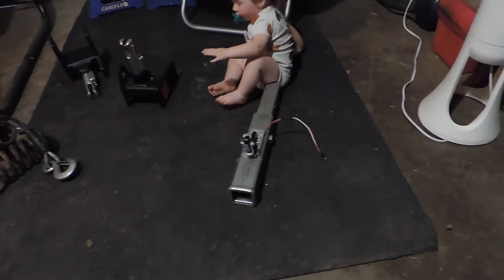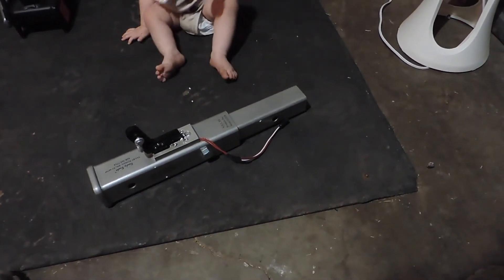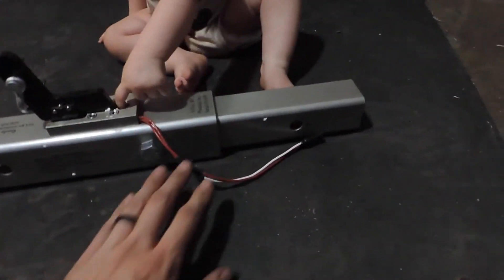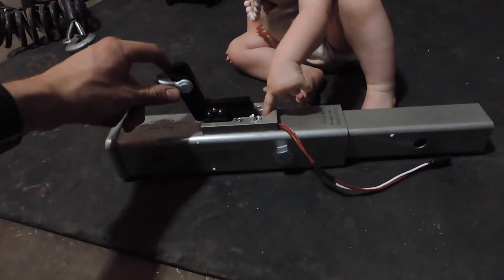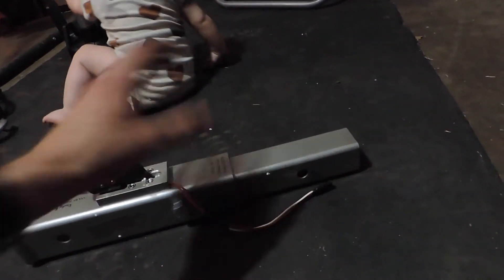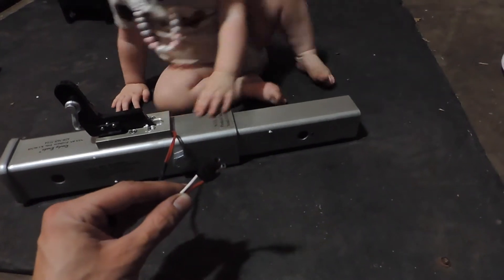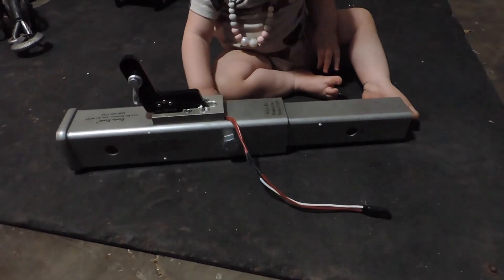I really did a lot of thinking on brake systems. The brake system I ended up going with is the Ready Brake by NSARV Products. The way this works: this part goes on the coach, your tow bar goes in this end, and a cable goes from this ring to your brake pedal. As you stop and your vehicle pushes forward, it collapses this piece right here and pulls this lever back, applying your brakes mechanically. It also has an indicator light that plugs into the dash so you can see whenever the brakes are being applied.